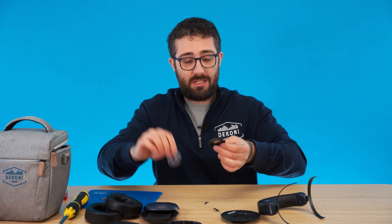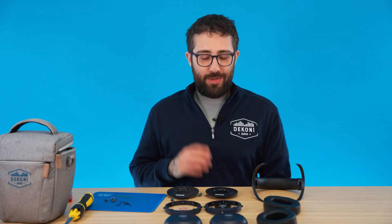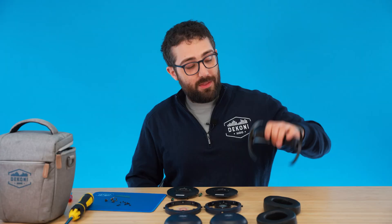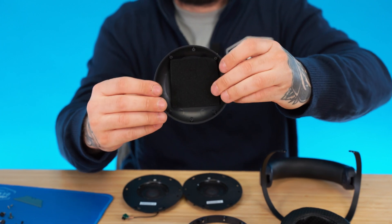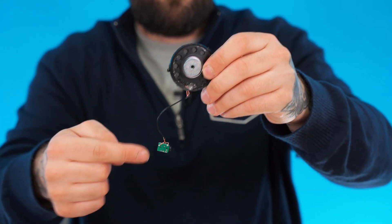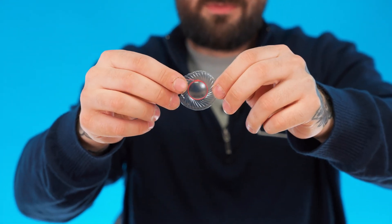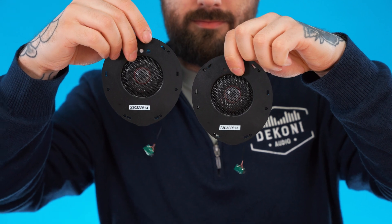And that's pretty much it — that's the Dekoni Hi-Fi Man Cobalt. Look how many pieces there are to a headphone just to make you guys comfortable. I'm exhausted from unscrewing all of this, but these are the parts of the headphone: you have the yokes and the headband, the earpads, the earcups and the parts that keep them together, the driver with the magnet and the attached 3.5mm connection, and the diaphragm and coil that are suspended in the magnetic field. Then we have the fascia with the drivers attached — why ruin a good pair of headphones? If you're interested in more information about the Dekoni Hi-Fi Man Cobalt, it's available now at DekoniAudio.com. Thanks for watching. We'll see you next time.